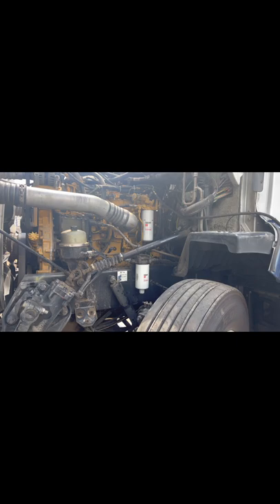After improvement from bypassing the primary fuel filter, I went ahead and hooked the fuel lines back up and changed both fuel filters. It did not have CAT filters — we run Fleetguard filters here at ETR; it's a good substitute. Would not recommend Baldwin or Wix, just throwing that out there. So after changing the fuel filters, the fuel system is primed. We're going to check our pressure again.